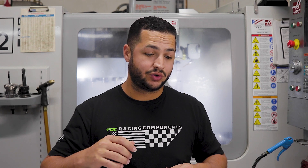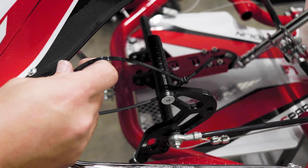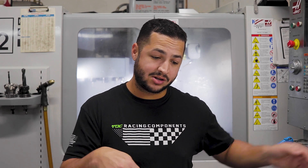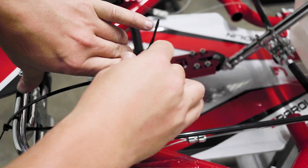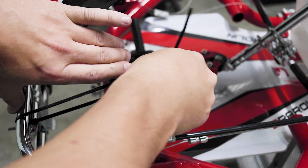One thing I always like to do if I'm working by myself is to get some zip ties and zip tie the brake closed. That way the brake kind of helps hold the rotor to keep it from twisting. When I'm hitting the axle out I'll push in the opposite direction that I'm hitting — so if I'm hitting on the brake side I'm gonna push the other way to keep the rotor from twisting. Make sure you zip tie the brake rotor or have somebody help hold the brake so that when the axle slides out it doesn't drop, hit the ground, and damage your rotor.